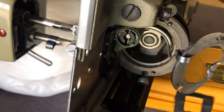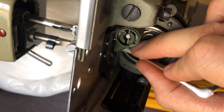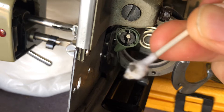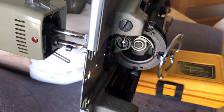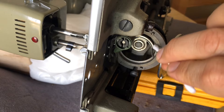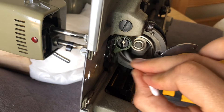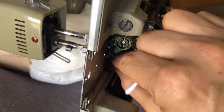I'm going to take a cotton swab and some alcohol and go in here. The race has a rim which will often catch dust and oil — you can see little bits of that coming off. You want to get this stuff out so that when you're ready to start sewing you're starting with a clean slate. This isn't like cleaning your feed dogs or oiling the machine with each new project. This is something you really have to gauge on your own to decide how dirty it is and how much it needs.